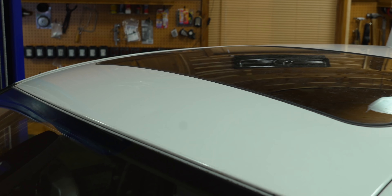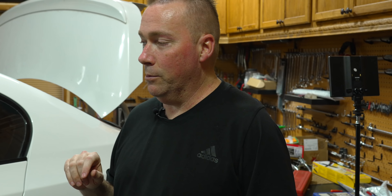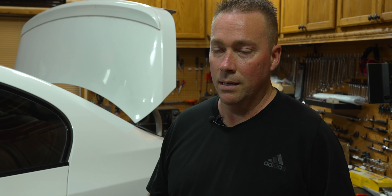We don't have a lot of check engine light stuff at all. It is running rough, so the approach we're going to take is I'm not going to try to fix it or do anything with it until we do the rod bearings — period. I think in this video we're going to pull the oil filter off and take a look at it to see if there's any metal in it, and that'll tell us the story beforehand.